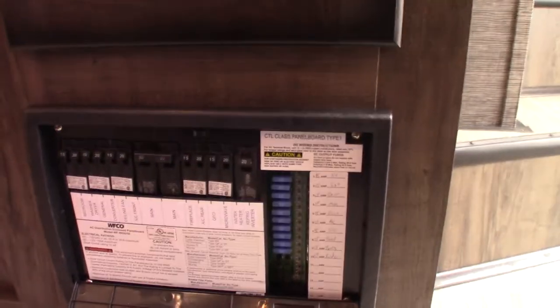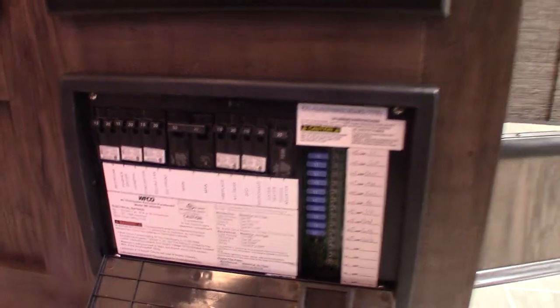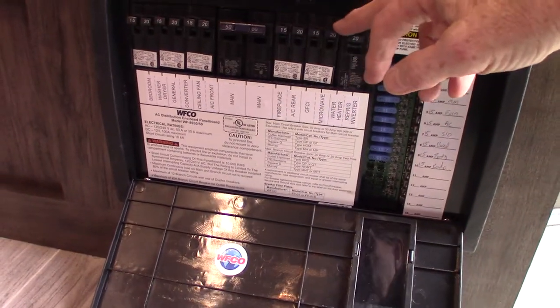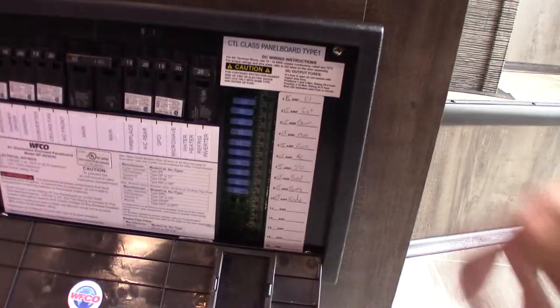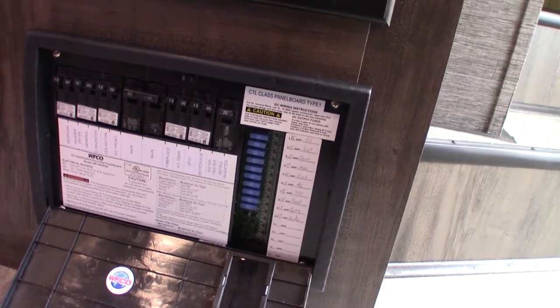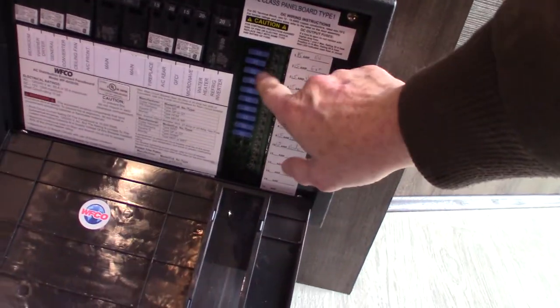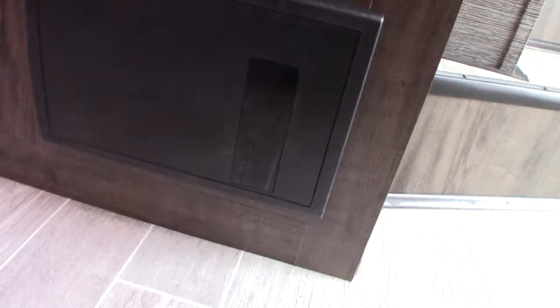This device here is your converter — the opposite of the inverter — it goes from 110 AC to 12-volt DC. You've got regular household-type circuit breakers like you'd see at home, all labeled, for AC power. On the other side you have 12-volt fuses, all labeled. This unit also charges your batteries when you're plugged in — it senses how much energy they need and keeps them charged. If any fuses blow they'll light up and you can see them through the tinted plastic. Your tow vehicle's alternator charges the batteries while pulling; the converter charges them when plugged in.